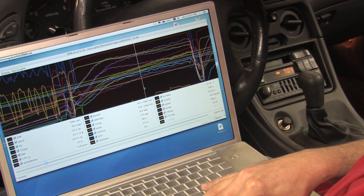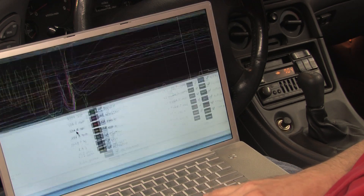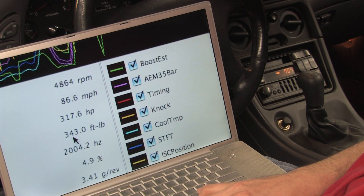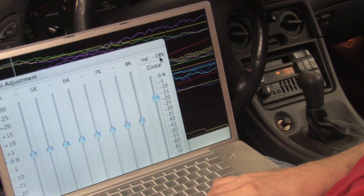I've been really happy with what I've eked out of this tiny little turbo and tiny little injectors. On this pull, I peaked at about 335 horsepower, and 400 RPMs earlier I'm at 343 pounds of torque. I've seen consistent 357s on my horsepower numbers, but my tune was very different at the time. Right now I'm doing this with a flat timing curve and a flat fuel map, but I'm about to do something about it.